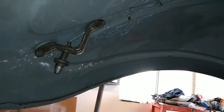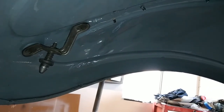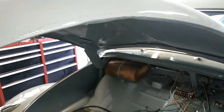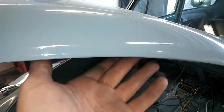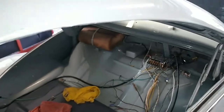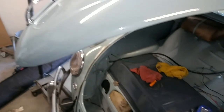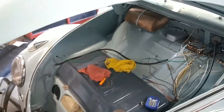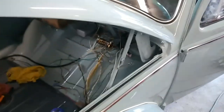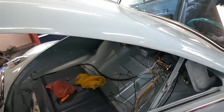I think that pretty much covers all the areas. It's hard for me to really do it without having one that I'm really adjusting on. Maybe with the GoPro on I can do that at another time and show you guys exactly how to do it. But every car is so different — there are just so many different compounded situations. Re-arcing can be difficult. You have to put wood blocks under here and gently tweak it back down to arc it out. This hood looks like it might be a little bit too far arced, so I might have to actually push it up and back, arc it back into position. You're talking about a sixteenth to an eighth of an inch, and it's hard to do that. But it can be done if you want it really, really perfect — if you work on it long enough.